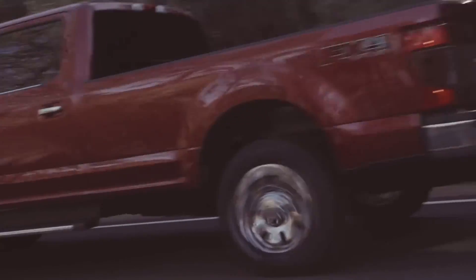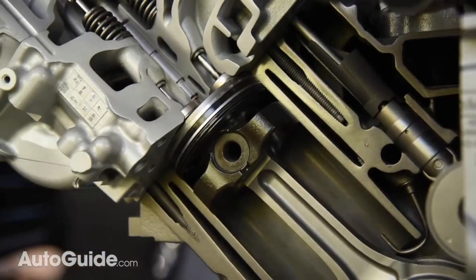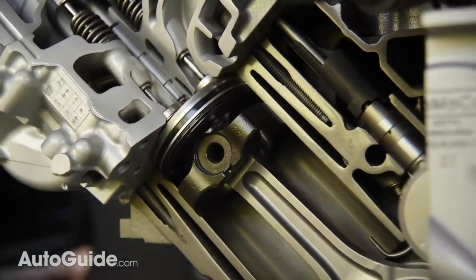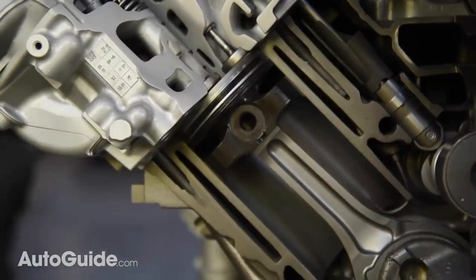After the cam, the next big thing is the pistons and rods. They're now using a high-strength steel piston, which allows them to shrink the skirt, and they're using a longer, stronger rod. One major benefit is improved engine geometry — a smaller skirt means less likelihood of skirt rub down low on these long-stroked diesels. On top of that, this piston is stronger, which is going to allow it to make more power. That's what Ford is going for: longevity and good, strong, durable engines.